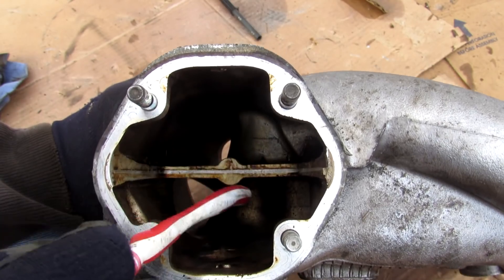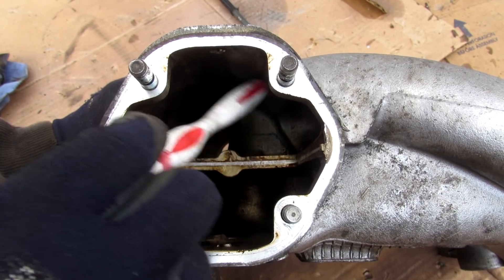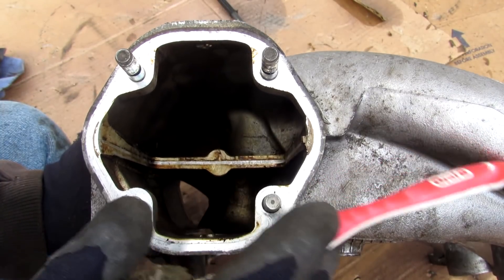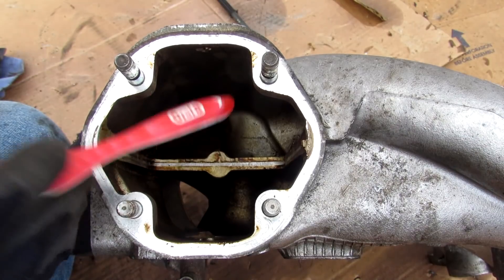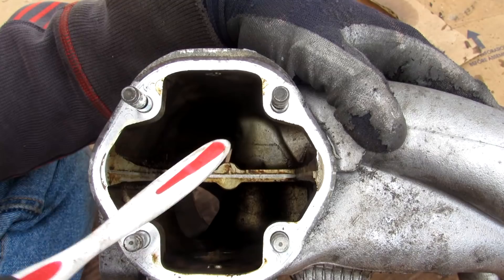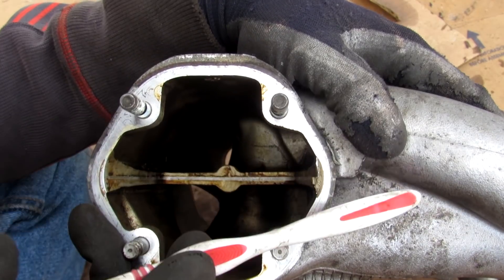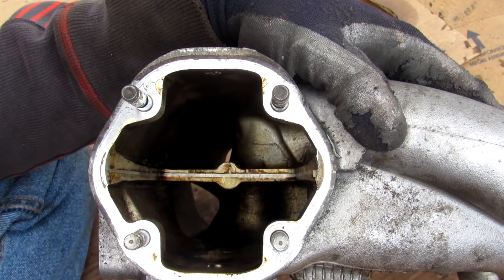The advantage of having the ACES plate sitting perpendicular at lower RPMs is it gives the air intake a longer path to travel before going into the engine. By optimizing the runner length, sound waves from further down clash with incoming waves, reducing noise at lower RPM — hence the term acoustic air induction system. The longer runner length also helps air accelerate, promoting fuel mixing, efficiency, and a little more lower-end power.